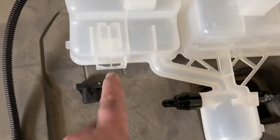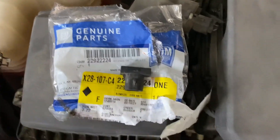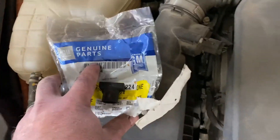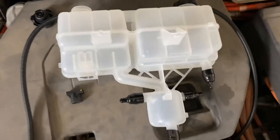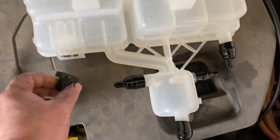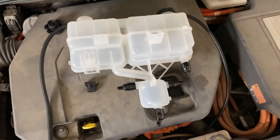Mine actually came with the tank, which surprised me — I wasn't expecting that. It is GM part number 22922224. I've got a bunch of three of them now. You can order this separately — I've done it twice now. It apparently comes with the tank I just ordered, but I didn't use it. It's definitely a separate part number. To replace this, you do not have to replace the tank. If the shop is telling you that, show them this video — they're full of crap.